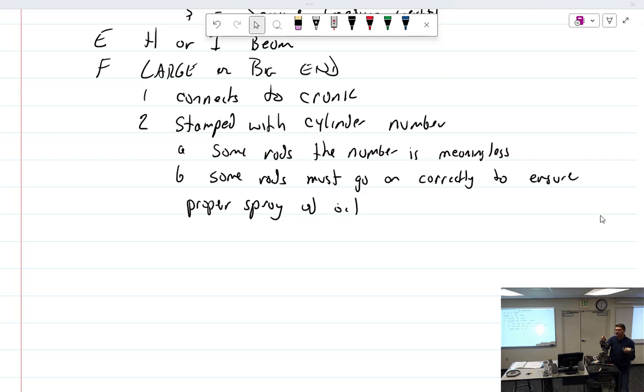Don't torque it and pin it until you verify it is the right orientation. Why do they do it that way? On your engine they had to number them, so rather than saying on some engines put the numbers on the bottom and on others don't worry about it — they just say put the numbers facing the bottom. Continental says put the numbers facing the top, but continental has the cam on the other side. So if I say 'numbers away from the cam' I'll always be right.